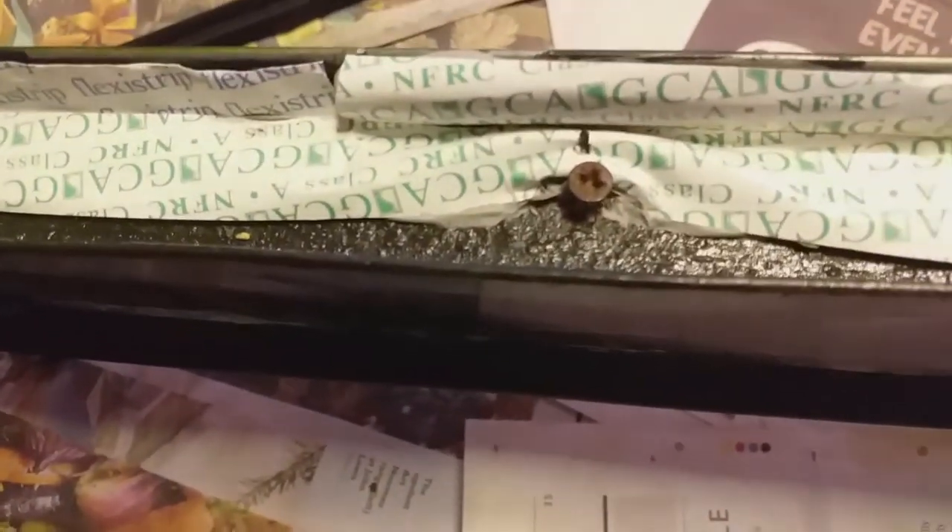Once I'm happy that I've got the correct level on that, the various Bostik press stick style sealants will be ready to fit the lower guide channel and the fixed pane of glass. What I'm going to do is actually fit that all together without removing the backing first — a dry run — and make sure that it all lines up. I need to be sure that the sealant isn't going to push the channel too close to the fixed pane of glass.